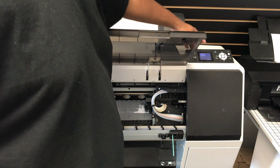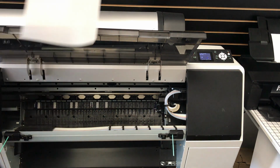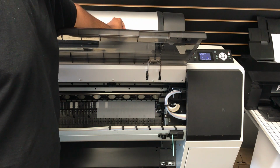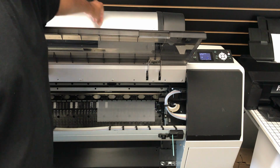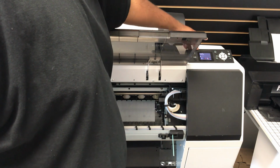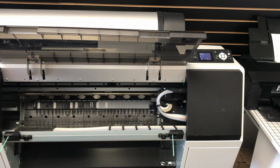When I press this, it says pause cancel or job cancel. So now I'm going to change the ink limit to 10%, and also instead of the 100% white, I'm gonna lay down gradient white so that it's a thinner pass. Closing the platen, pause button. You should read it. After it reads the sheet, I'll update the page settings. I'll keep it on the widest platen. We're laying down the gradient white at 10%, even on that.